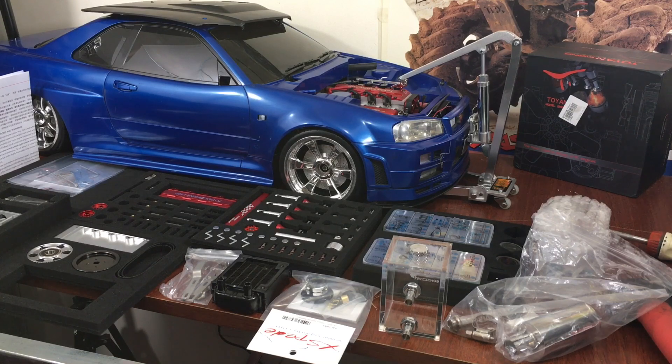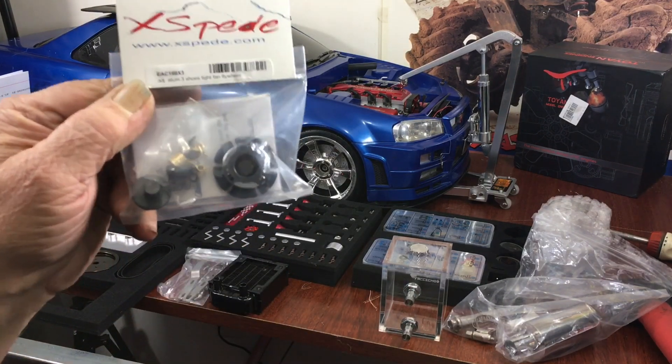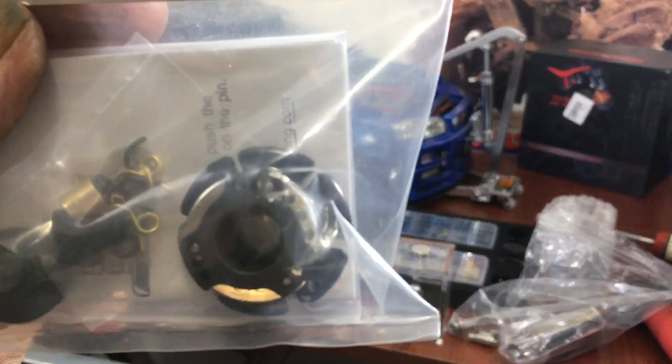He's going to try to set up a fifth-scale, big weed-whacker engine clutch on it. I don't know if it'll work honestly, because these engines are small. They do produce a lot of power and torque, but it might help with the inertia of the weight to keep it idling properly. But it's got to be a super lightweight spring clutch on it to take off, and sometimes if you get something too big it could stall the engine.